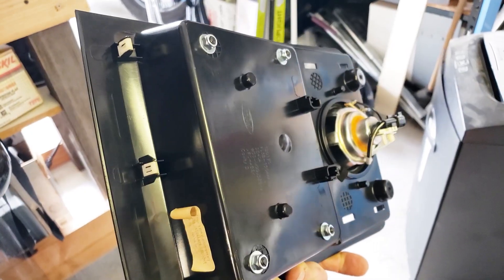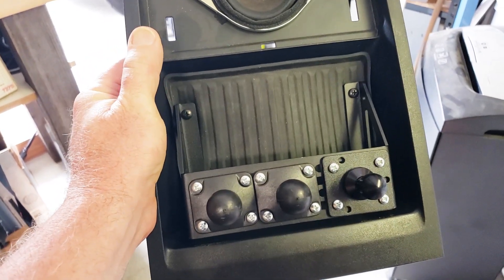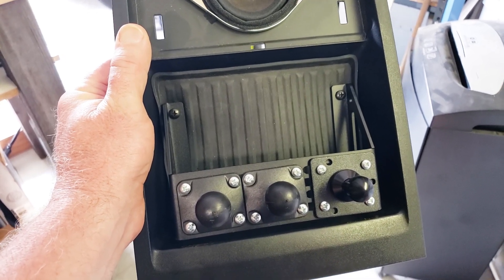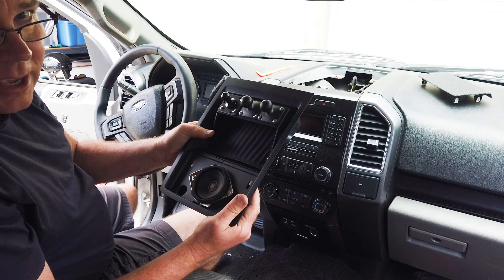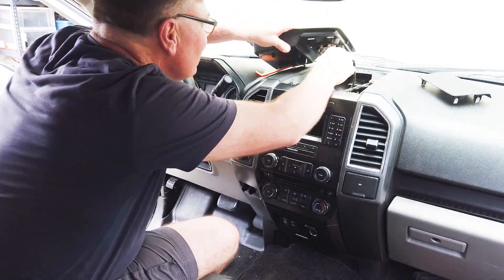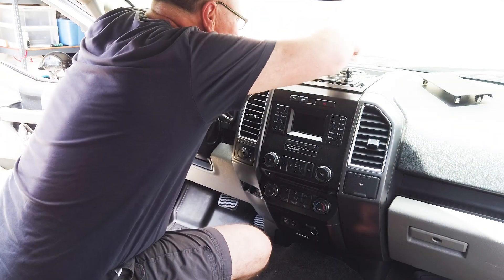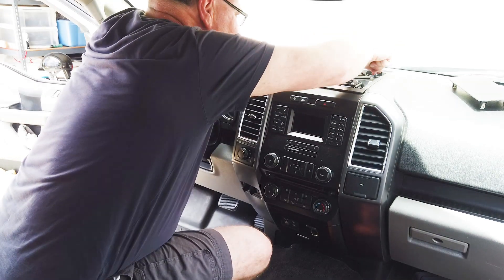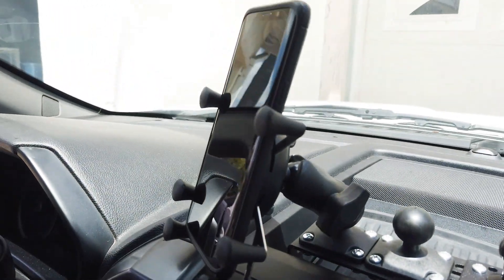I've got my four bolts attached on the bottom. There's a little bit of a bow in the rubber underneath just from the way it tightens down, but that's not going to matter — it still won't have hard things against the hard plastic, so there'll be a little bit of protection. Now we're ready to put it back in. It goes back in the opposite of how it came out — remember to hook up that center speaker — and then it goes back in to those two screws and it's just a matter of popping that back into the clips.